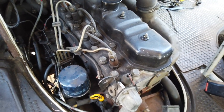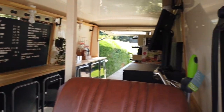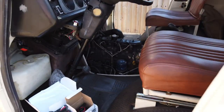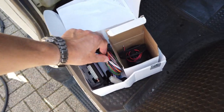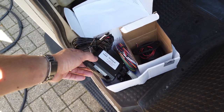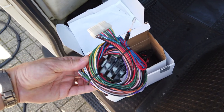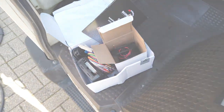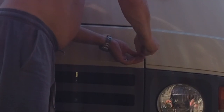I'm going to put a couple of sensors up the top looking down the back of the van, because with the sliding doors we've got no door switches like on a normal car, so the ultrasonics are going to be the main pickup inside. You can set this one up to run central door locking if you've got that fitted — there are loads of different ways to wire it and the instructions are good. Let's crack on. The front grille — pop a screwdriver in and turn these little latches.